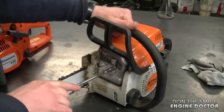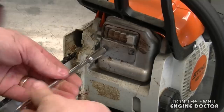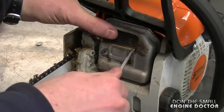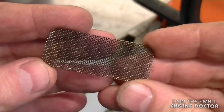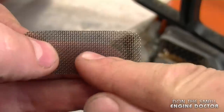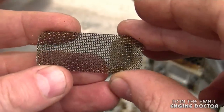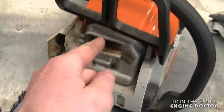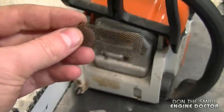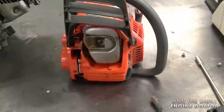What I've got here is an MS 170 chainsaw. I'm going to show you where the spark arrester screen is — it's right here. You remove the two nuts over here with an 8mm T-wrench, and once you remove this cover you can see the spark arrester screen. Basically it's just a screen, and what happens over time is carbon builds up on it, plugging the exhaust flow out of the engine — that's where you start to have problems. In most cases if you completely remove this screen and put the cover back on, you may find a bit more power in your chainsaw. I've also seen people make bigger holes in the screen and put it back on.